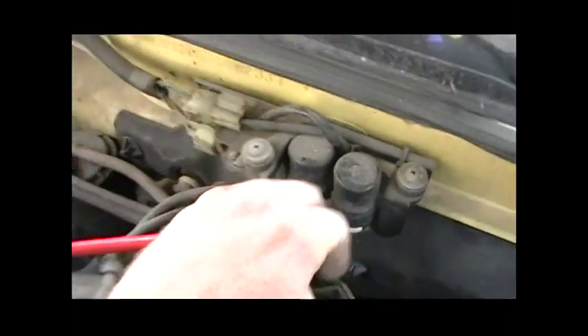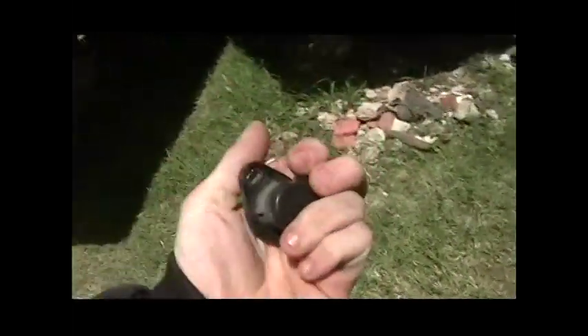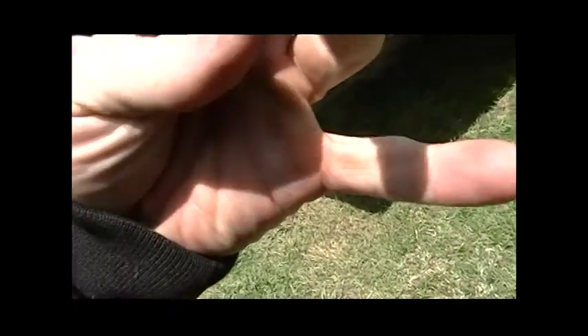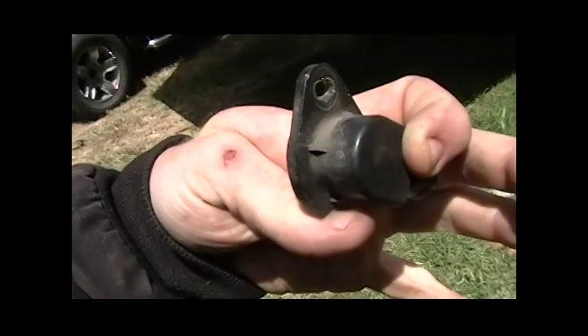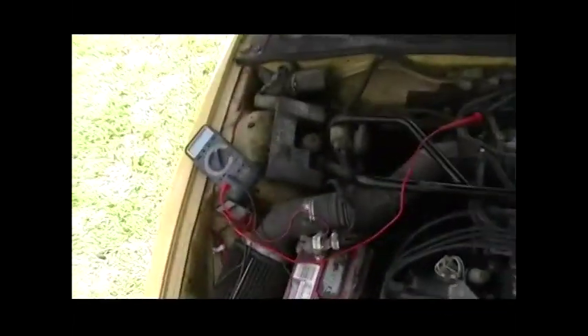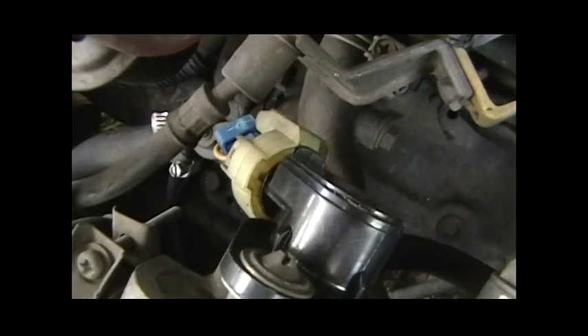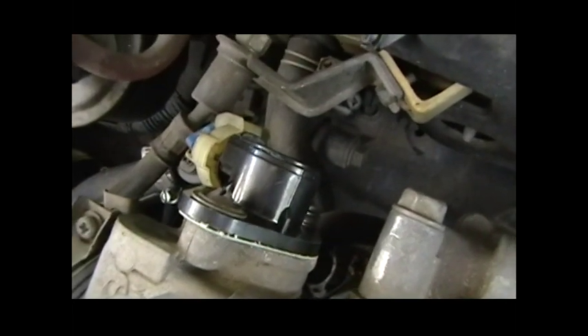You'll have a choice. Either you use a Dremel — I'll show you the old throttle position sensor. If you look at the back of the engine, there are two holes where there are screws, but the screws have rounded heads; you can't really grab onto them. So what you've got to do is either use a Dremel and a metal cutting wheel and cut a channel in the center of the screw — can you see a channel in there? — or basically break the throttle position sensor off of there.